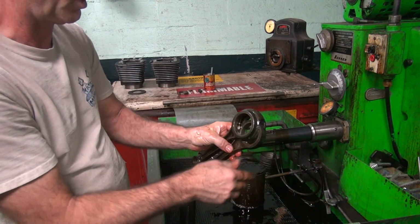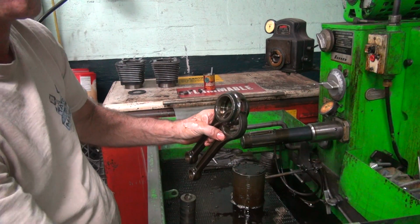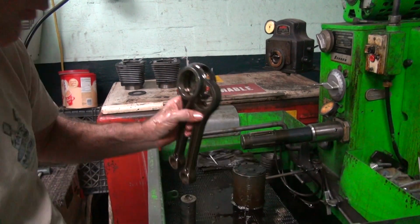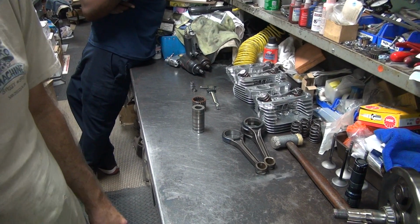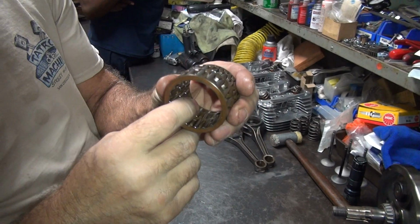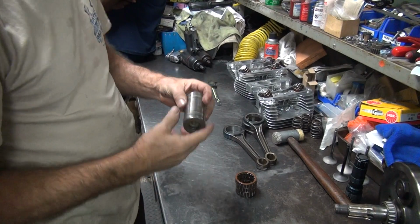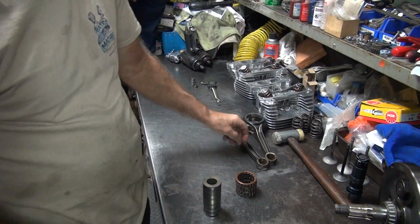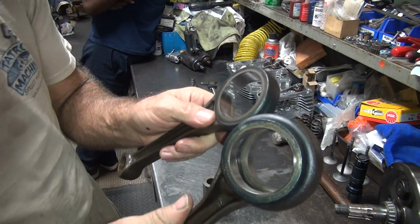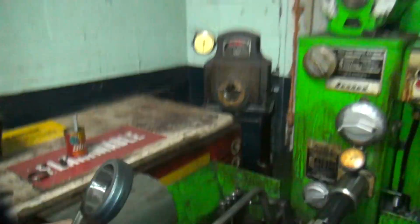All this stuff up. I'm gonna try a different crank and different bearing to see if the problem is these parts or what. So I'll be back. Alright, we're back. Okay, so I swapped bearings out. These are 2/10 smaller, or 1/4 thou smaller, so it gives me a 1/2 thou more clearance. The crank pin's the same size as the other ones I got. And I honed the rods out so that they're more equal length, more round and square. Go back over and show you. So they're a little bit bigger too now.